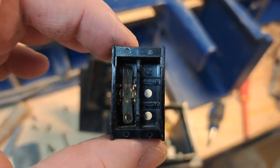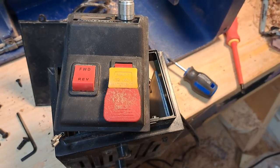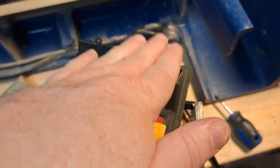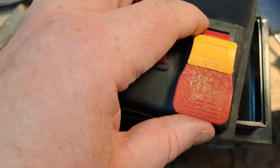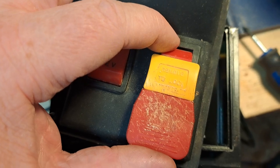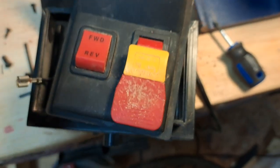I'm going to take a look at it, clean it up, and see if it will work without me having to buy a replacement. All I did was make sure that little piece of metal that rocks on a teeter-totter was cleaned up — there wasn't really anything dirty about it, but it didn't seem like it was seated correctly, like somehow it had come out of its position. I got it put back in and now if we listen we hear the click when it opens and then the click when it closes.